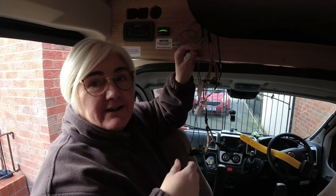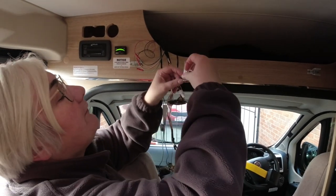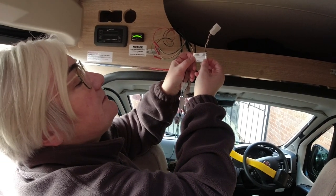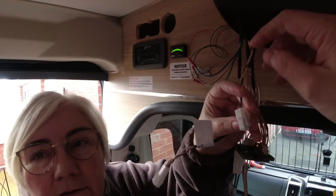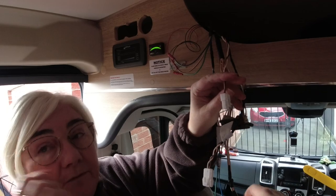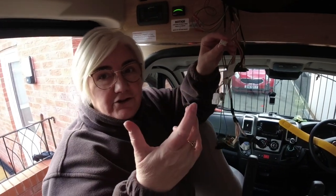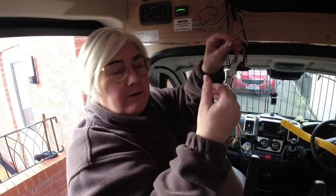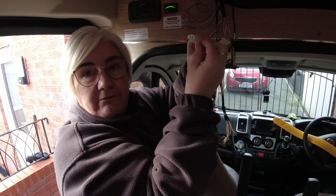The other thing to mention is always try to find a negative that's always going to be connected to everything. Because this cable actually says on it 'awning light harness.' Some people may not have an awning light, but it's basically a generic harness that the van is fitted with — so even if you've not got an awning light, you'll have this plug sticking out the back. And the other thing to remember is the same as your sockets at home: there's something live at the back of them, so it'll always be a female connection. Your plug is the male connection — the female's the one that's got the power on it. The male plug side can't do anything until it connects into the female.